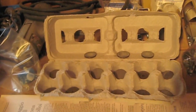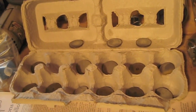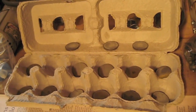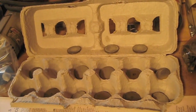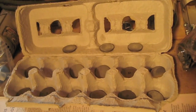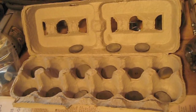When I pop the shims out, I keep track of them by putting them in an egg carton. I also lined up the brand new shims I had to purchase. You want to stay organized when you do this job because there are calculations involved, lots of valves, and it's really easy to make a mistake and put the wrong shim in. Here's what the whole work area looks like.